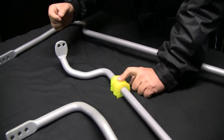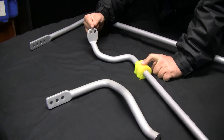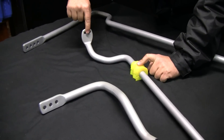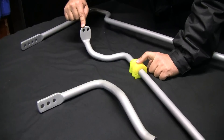With advertised sway bar rates — because we often get asked what size is that sway bar — on a two-hole sway bar, the advertised size, say 22mm, is actually right in the middle of those two holes. So this is actually a 22.5mm or a 21.5mm sway bar. Moving away from the D-bush makes the sway bar softer.